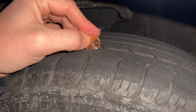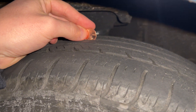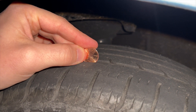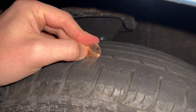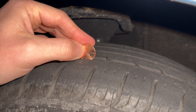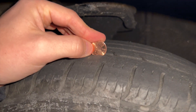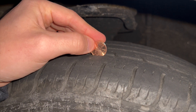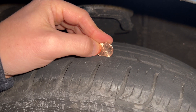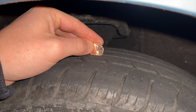That's something where we'd definitely recommend changing the tires. If all tires are relatively the same like this, it isn't a terrible cause for concern with the wearing. I would say this tire doesn't yet need to be changed completely, but definitely in the next couple of months. And something to keep in mind — if you guys live in the northern states that have a lot of snow, rain, and freezing rain, I would recommend changing them if you're at this tire depth and winter is coming, just to have a little more stability on the roads during inclement weather.